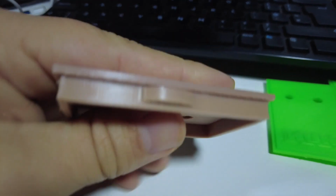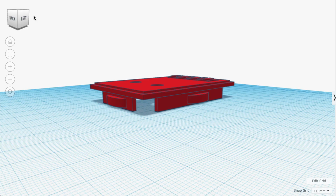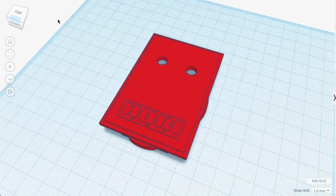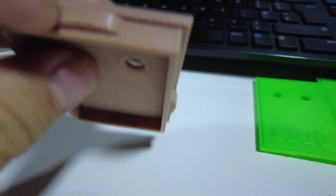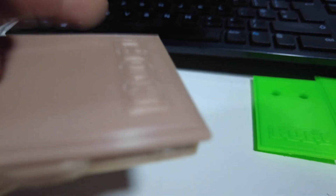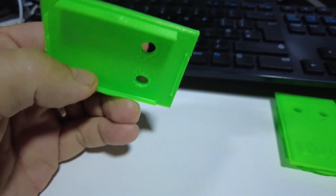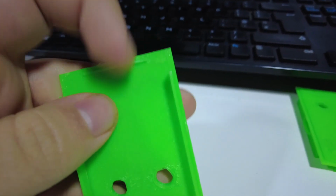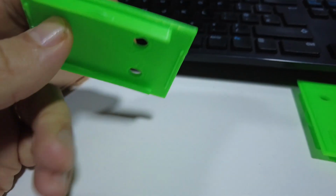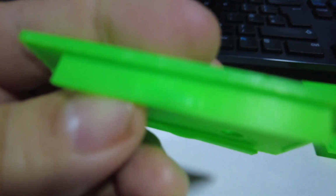And I started getting into this almost latch type approach, where each side of the piece I put like a border further down, and then each side of it has got this little latch. But first of all I only gave it 1mm, which was way too small. Printed that out, no good. Next one I printed out, I cut the corners out of it, and I did 4 pieces, but I made these side bits 4mm down now for that latch, which is cool. This is going to be hard to show on the green.